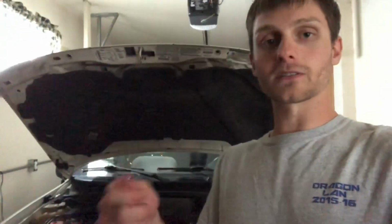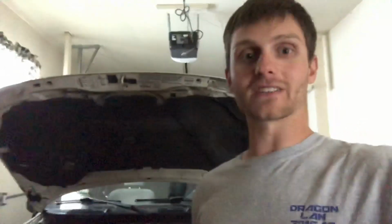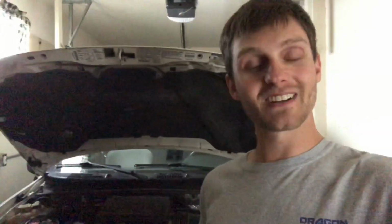Three times, I believe, is what it is. You plug that in, turn the key three times, check your pressure, write it down, move to the next cylinder. Luckily for me, I can do it eight times. Got that V8.